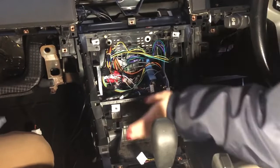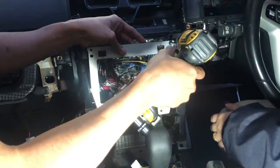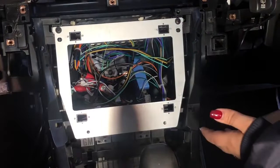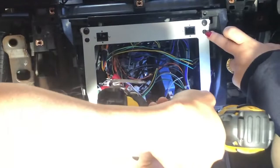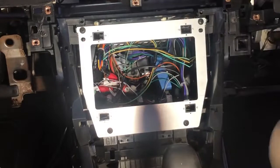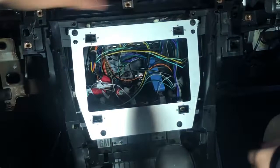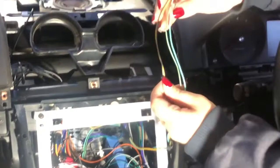To run the mic end to connect to the unit, there's a little hole right underneath — just pass it through there. That's fine — it can just sit that much since the unit is right above anyway, so you don't want too much extra wire. The next step is to put the bracket on before we put the unit. Push all your wires out of the way when doing the bracket, as they can get caught between the bracket and the plastic as you're screwing it on.